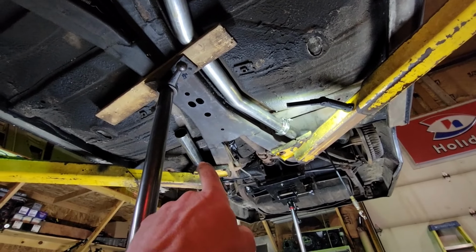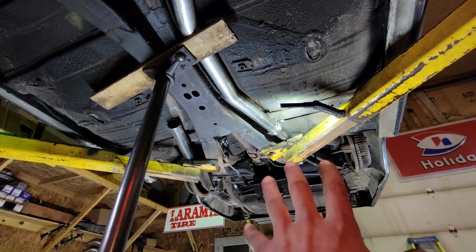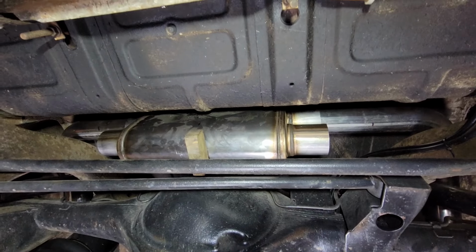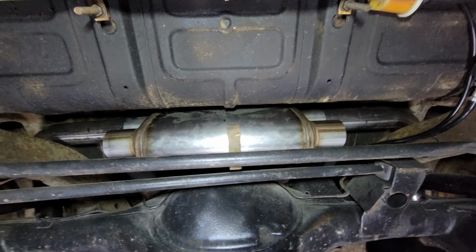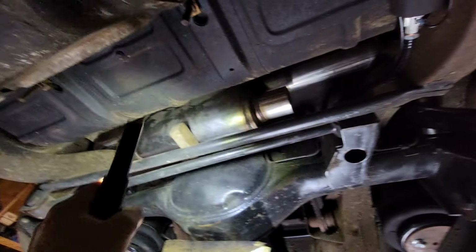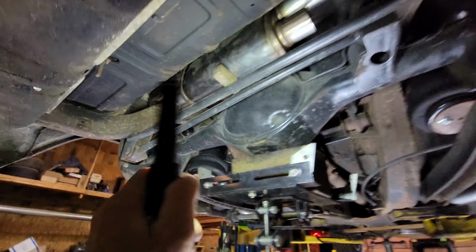Well, in order to get started on this other side, I need to trim that pipe back. But I got that muffler right where I want it, and I don't want to disrupt that. And these pipes, I think I can show you here, if I get a light. These pipes shove into that muffler, and they're not absolutely straight, but straight enough to get in there. So pipes don't slide in and out of there very well. So when I pull this pipe out, I'm going to end up screwing that all up. So I think we need to mount that side of the exhaust first.